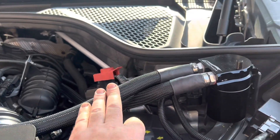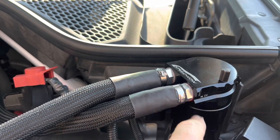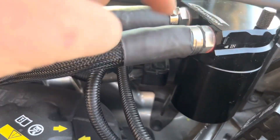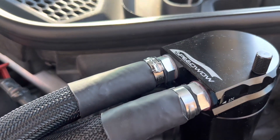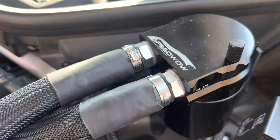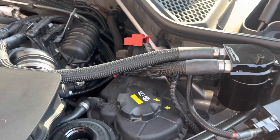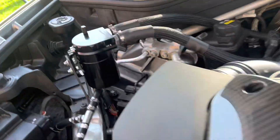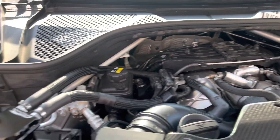Very important: keep this system airtight. Instead of the rubber O-rings that come with the kit, use crush washers and red Loctite so nothing spins off. Also use spring clamps instead of regular hose clamps — regular clamps can cut into the hoses and won't hold pressure evenly. This prevents any possible air leaks past the mass airflow sensor. Crush washers and red Loctite on both sides, with spring clamps throughout.